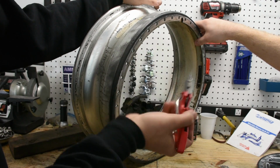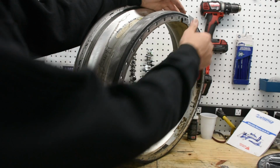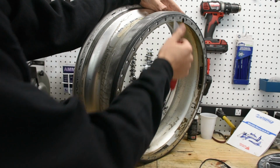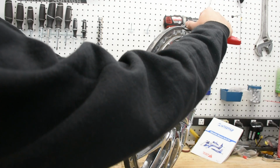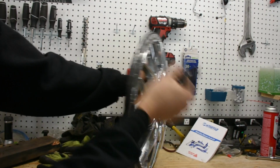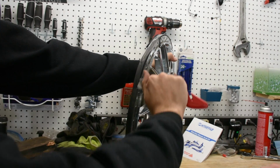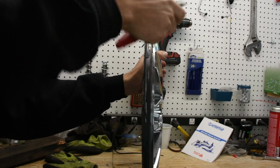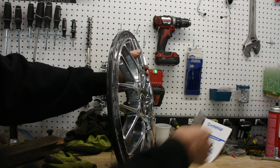Now that this seam is split, we're going to have to apply a new bead of silicone over here, which means we're going to have to remove the old bead of silicone. The easiest way that we've found to do that is just to run a razor right there and essentially cut off all your silicone. Here's the face too. You can see, just run it along the top. So you basically remove all that right there. Continue going along it. You can also go along the edge, clean all that off. And also remember to do this away from you, not pulling into you like I'm doing right now. That's just for a safety precaution.